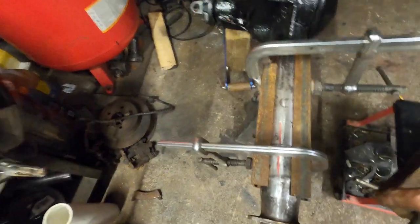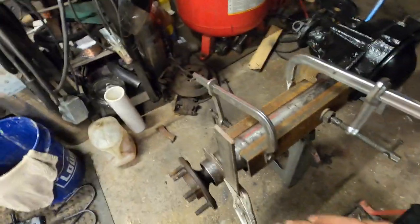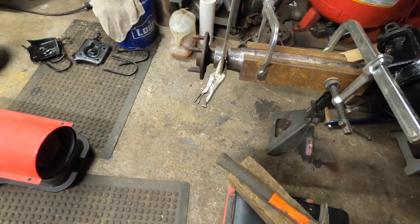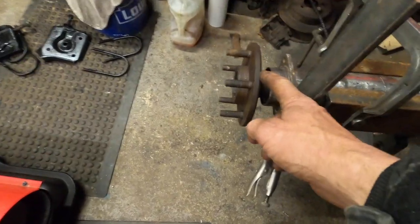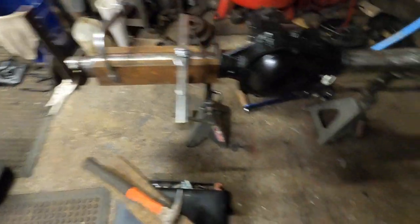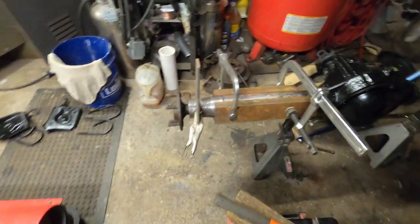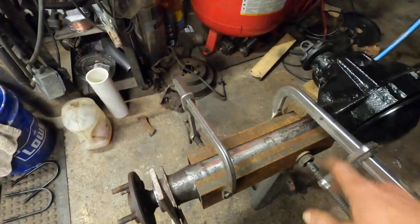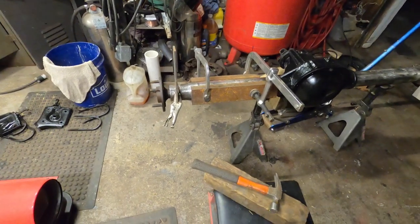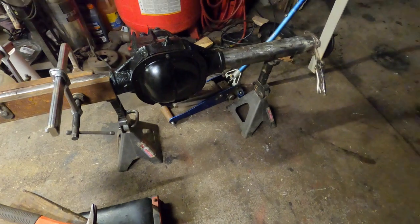But as you can see, I got that red line there. That's so my calipers are gonna clock the same way. I put the axles in. Measured them from the edge of the tube to here. Same exact thing on each side. I took a measurement from outside to outside on both sides, and we're there. So I'm going to take the axles out, and I'm going to take this all apart. I'm going to bevel the edges, and in the next video, I'll be welding that thing back up, and I'm going to show you how I'm going to set the pinion angle and put on spring perches.